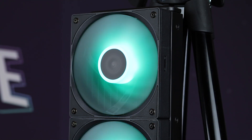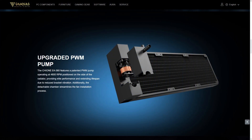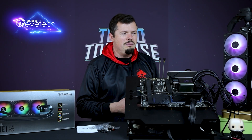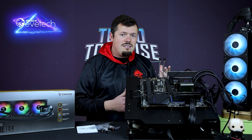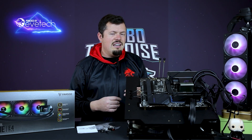And then we get to this thing's star piece. In the way they've set up this pump, they've put it side-mounted on the back of the radiator. So at the bottom over here is actually where the pump is sitting, and it's a 4,600 RPM pump — about 50% faster than the industry standard. The audio profile does lose some sound dampening by not being input into the pump face or connecting block in the middle of the radiator, so it is losing some of that dampening.